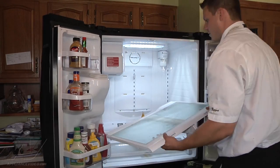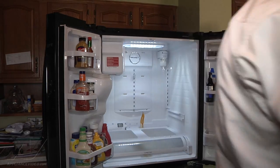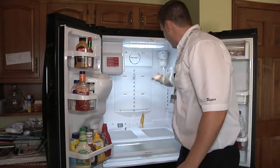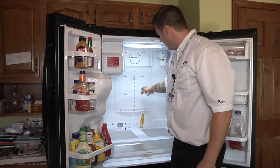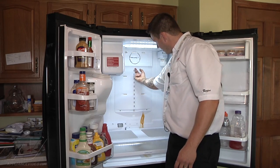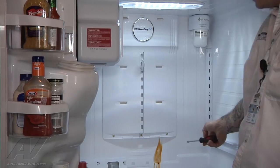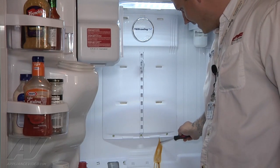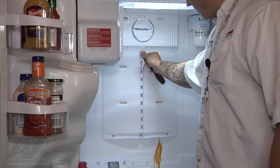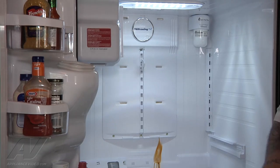Alright, that's as far as we need to go. Now we can see that hole back — we'll call it like a damper assembly — and this whole piece has to come out. There are some screws in here: one, two, three, and there's one hidden behind here. I'm going to use a flathead screwdriver to expose it. We've got a good view of where that water's been leaking out instead of going down the drain like it should. I'll pop this little cover off, which will expose our fourth screw, and we're going to remove all four screws.